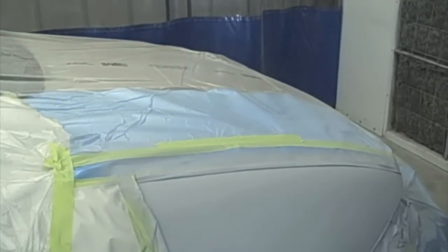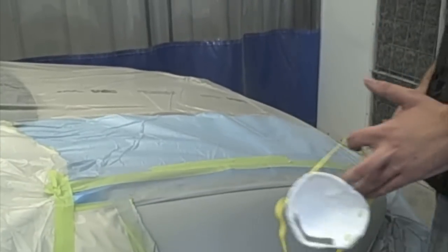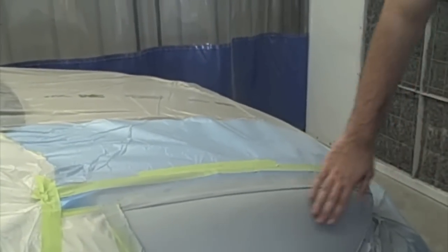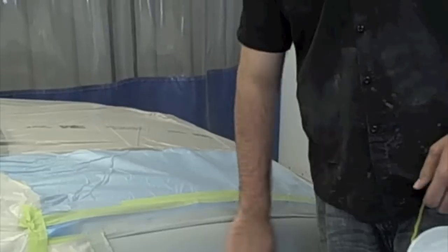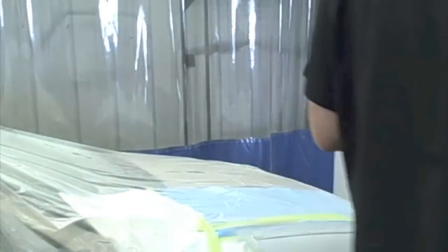We just epoxied this for adhesion purposes and then corrosion protection. And then we put some primer surfacer on it to give us something to sand so we can get it ready for paint. So we're going to jump into this with some 320 grit on the blocks so we don't leave bad scratches. That way we hopefully won't have to reprime it.